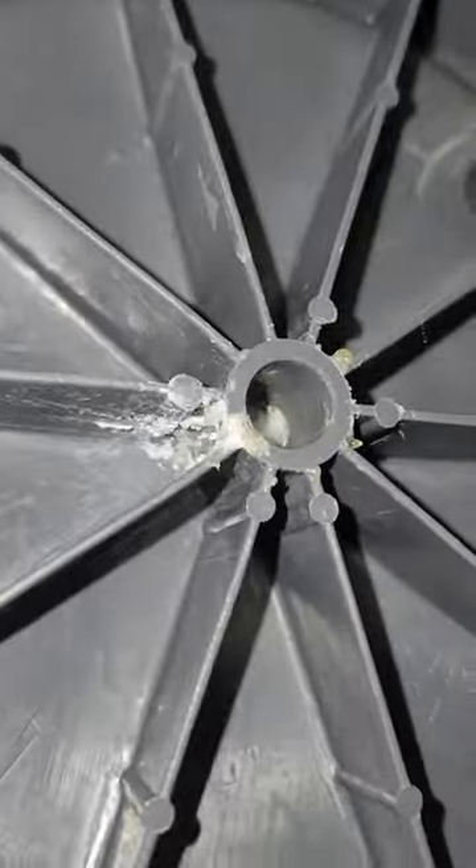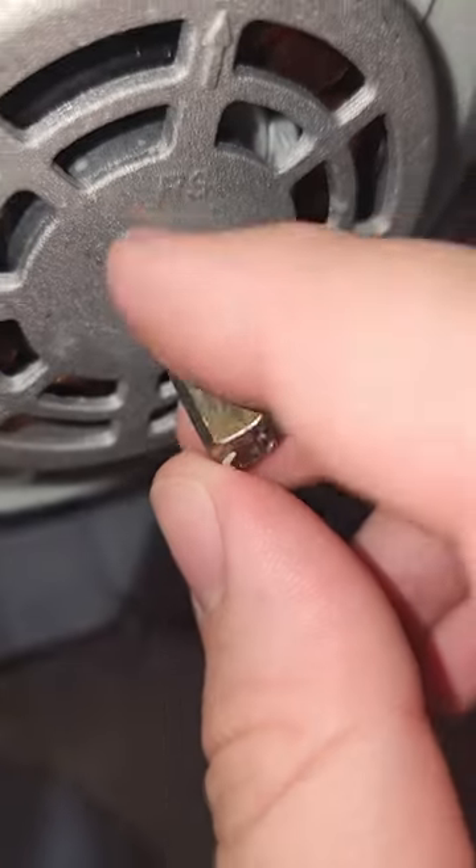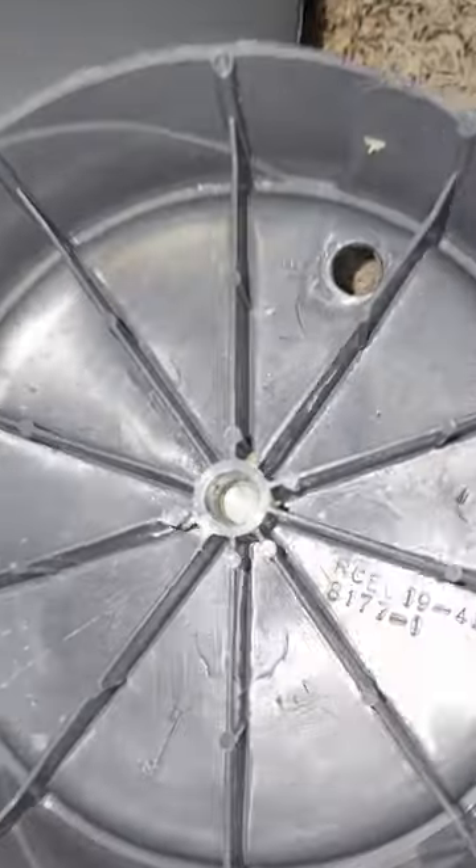Right now I took apart the motor assembly. There's where the crack was, and you can see there's really no keying. The motor has a flat edge right here, but the fan blade doesn't, and that shows me that there's no key.